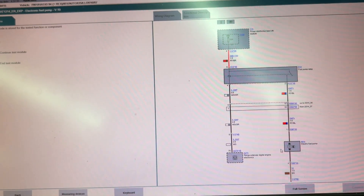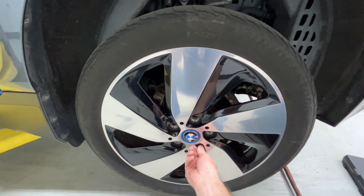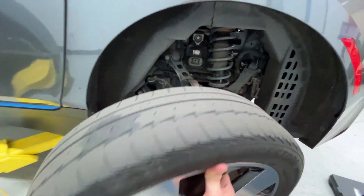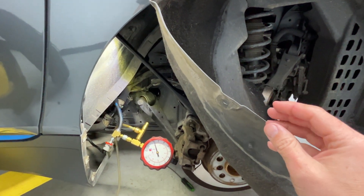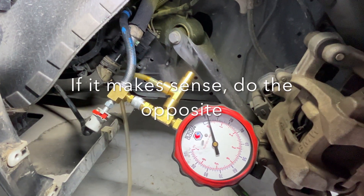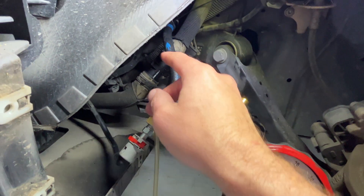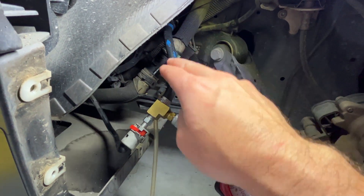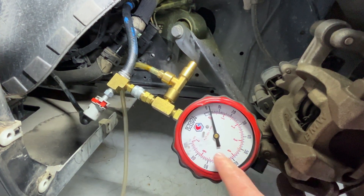I have to check this manually. The connections are behind this wheel, in this area here, so I'm going to take the wheel off. We had the fender liner peeled back in the left rear — and for some reason BMW uses three types of fasteners and screws for one piece of plastic. Anyway, that's the story of BMW. We have the fuel pressure outlet and return over here, and we're tapping into the feed line going to the engine. We'll run the test plan and see if fuel pressure is in spec.